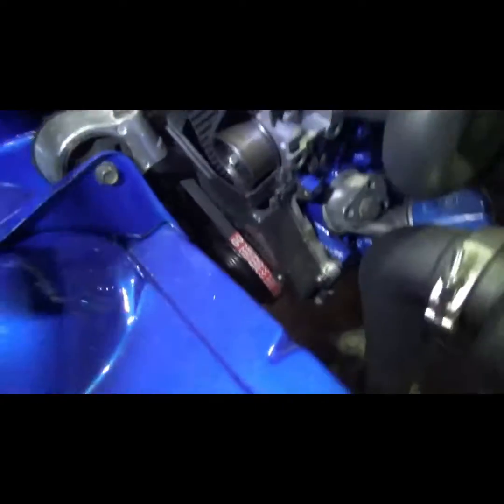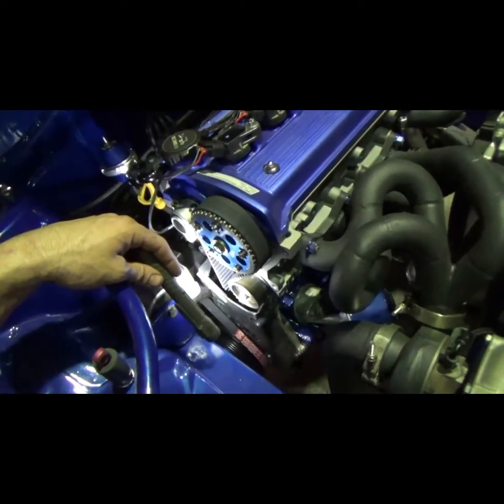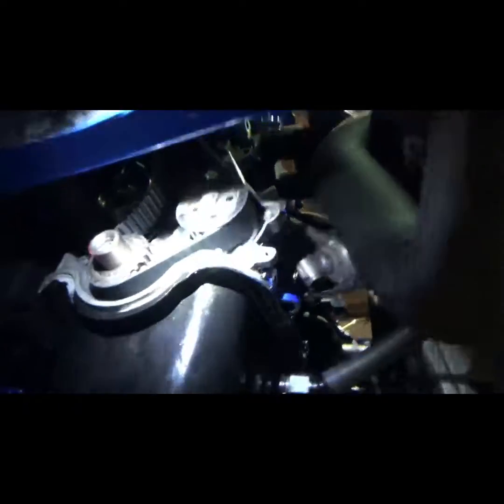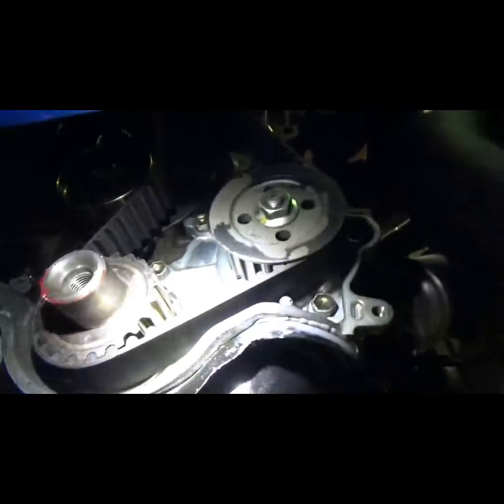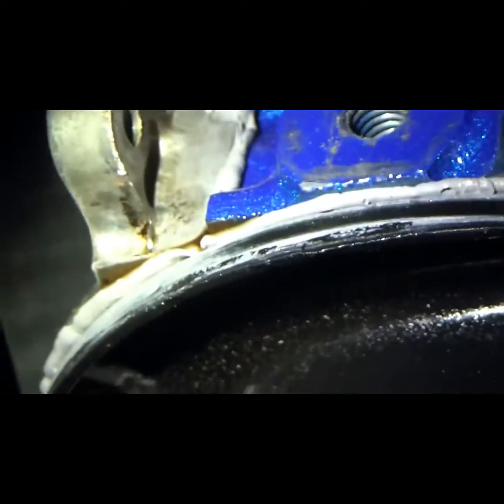After all that, there's an oil leak somewhere. So we've got an oil leak behind the timing cover somewhere. Pull this timing belt off and we'll have a look in there and see what we can find. So I've taken the harmonic balancer off. Luckily none of the seals are leaking because they're brand new. Oil pump's not leaking. Looks like there's something leaking out of the corner there. So I'm thinking I might just give that a degrease, put some sealant in there, and that's just going to have to do for tomorrow. It's only just dripping, so it's not too bad.